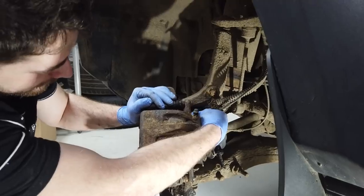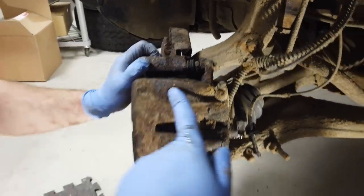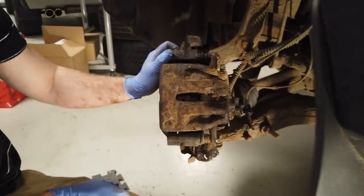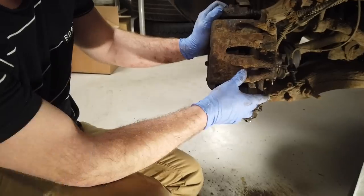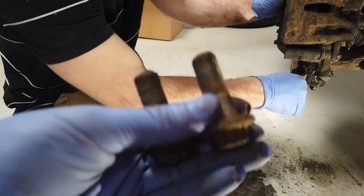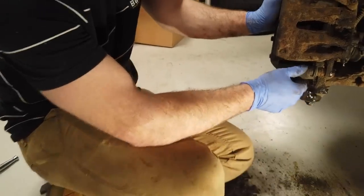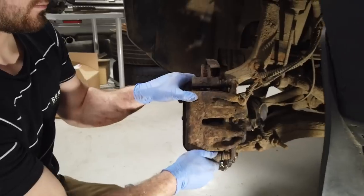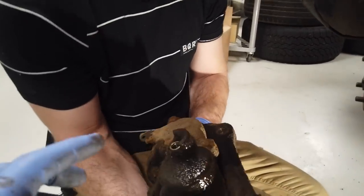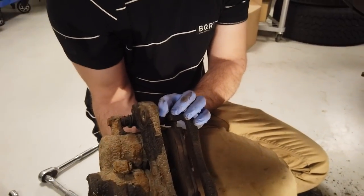There we go, we've got those loose. You can get a bit of WD-40 down in behind here - there's a little bit of thread at the end that protrudes just behind the disc and the last few threads are rustier. We've got them both out now - we're going to reuse those. You may have a brake wear sensor, but we're putting a new one on so you can just cut that off. There's the caliper - that's the old caliper. The pads are okay in there, it still seems to work, but it's as rusty as anything. So we're going to get rid of that.